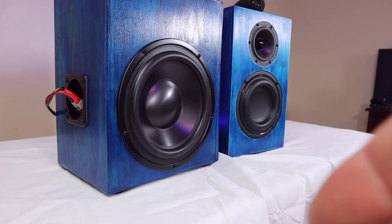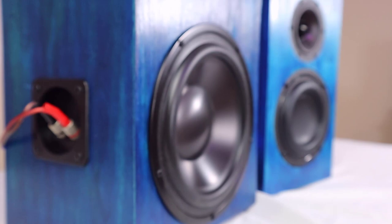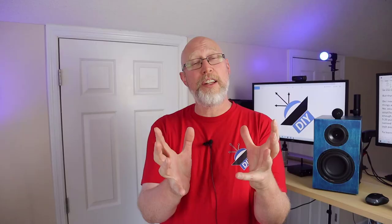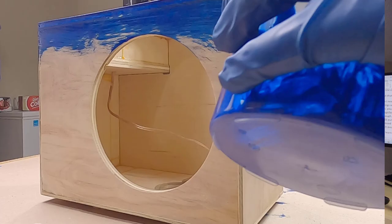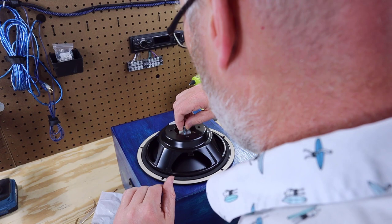So, now it's time to answer the big question: do I need a subwoofer? Well, if you're using these as intended — as a bookshelf speaker or maybe a speaker on your computer desk — you absolutely don't need a subwoofer. That five-and-a-quarter-inch driver, believe it or not, produces plenty of bass. Obviously this will not work for a home theater setup; if you want to hit those low notes for explosions and low-frequency effects, you are going to need a much larger external subwoofer. It's highly recommended that you do some equalization on these speakers — at the very least you need an amp with a simple tone control. You're probably asking how this little five-and-a-quarter-inch speaker can make so much bass. Well, here's the secret: you probably noticed a great big hole in the side of the enclosure. That hole was for this right here — an eight-inch passive radiator. The best way to get a lot of bass out of a small space is to use a passive radiator. To learn more about passive radiators, check out this video right here.